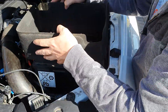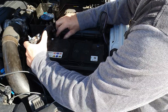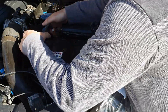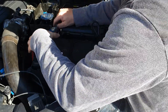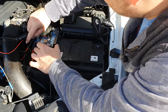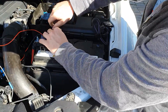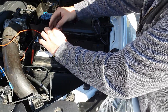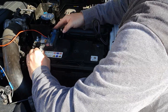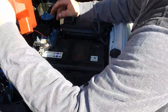Now slide the carpet cover over the top. To reconnect the positive terminal, the easiest thing to do is connect up the small connector first so it's out of the way, then drag the terminal across and get it back on. Tighten the lug itself until it's tight and not going anywhere, then put the bolt on at the back. Connect the alternator cable back to where it was. Double check that the positive side is all connected and tight, then put the red cover back on — that's the positive side done.